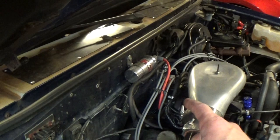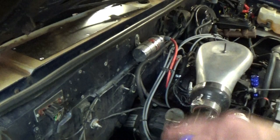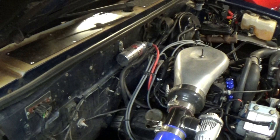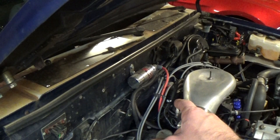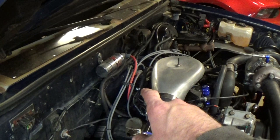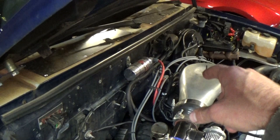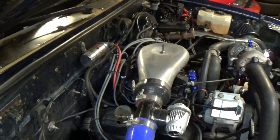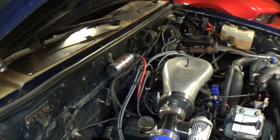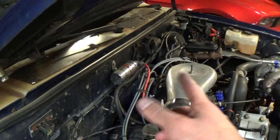I am not running the factory Magnum crank position sensor at all — it would normally be mounted on the side of the transmission. What I am running is a hall effect distributor from a pre-Magnum 3.9 liter V6. The pre-Magnum 3.9s had a hall effect sensor in the distributor that functioned as both crank position and cam position, and that sensor is directly compatible with the MegaSquirt 2. You do have to get the correct plug wires, cap, and rotor, and you can buy them brand new on RockAuto.